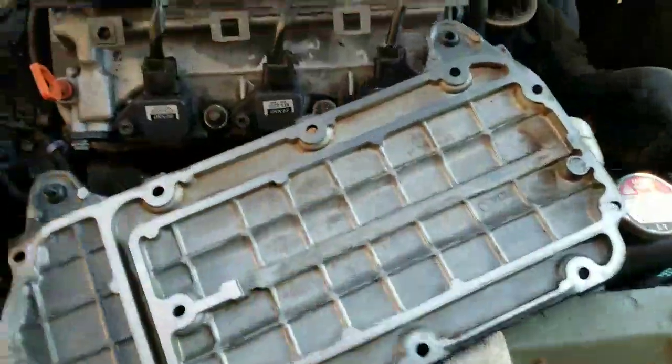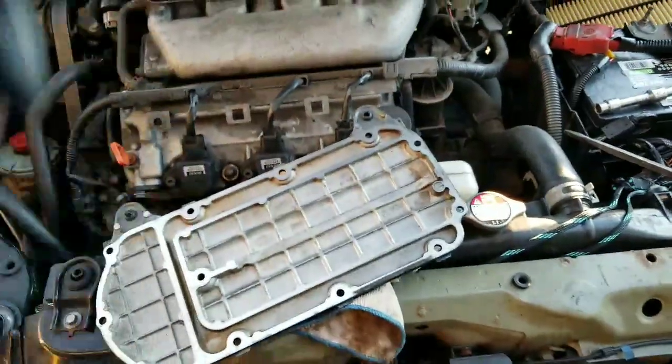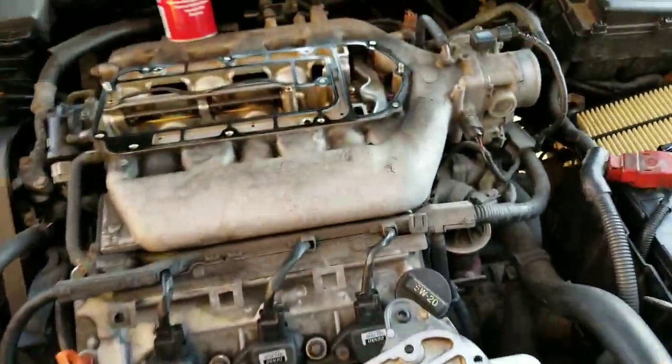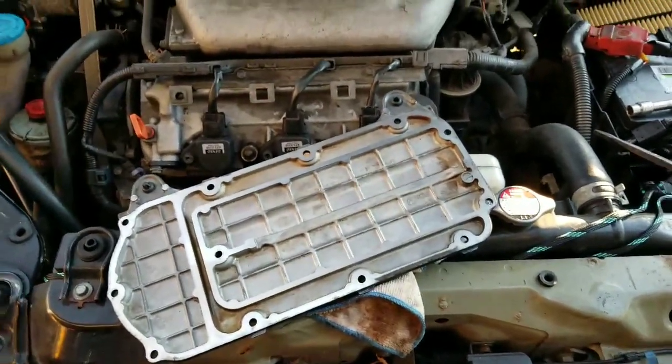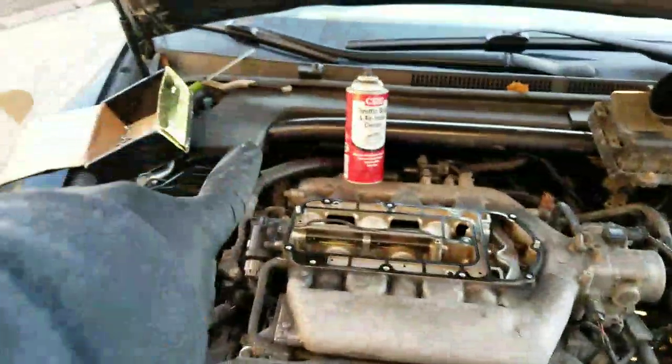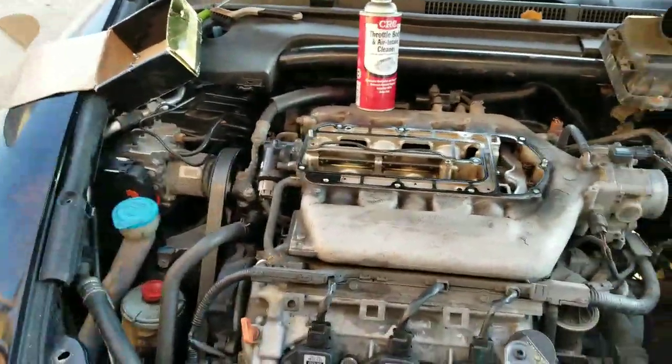Side mount — this one's broken, so I'm going to replace that. Just clean it up until it takes the manifold cover. I'm going to have some pictures for you guys showing what it looked like before. When he leaves here, his car should be running really smooth. The acceleration should be smooth and it should pick up quickly. I'm going to adjust the throttle position sensor in the back too, because I'm pretty sure it has some slack in it.